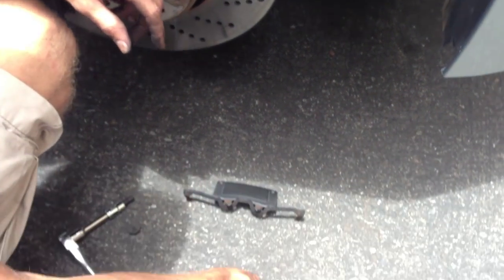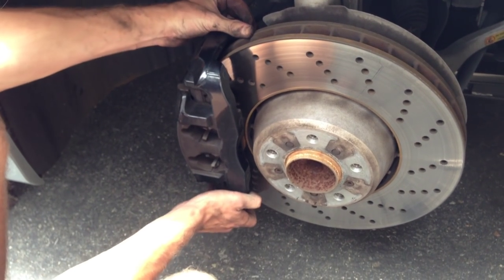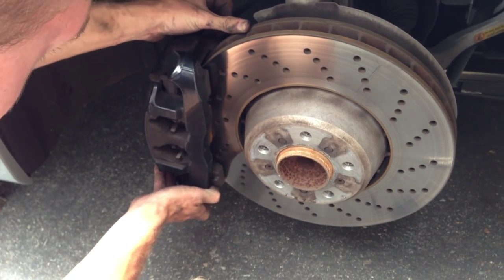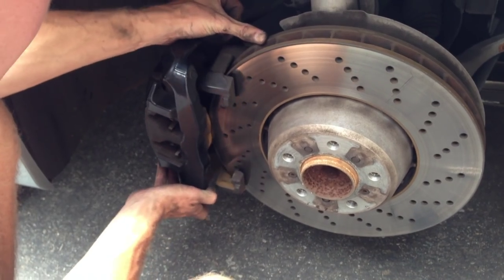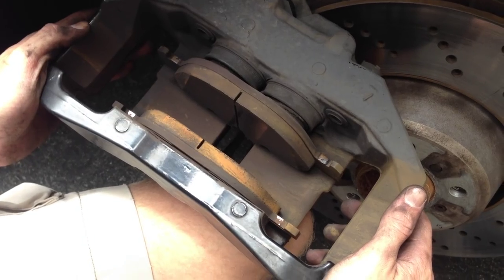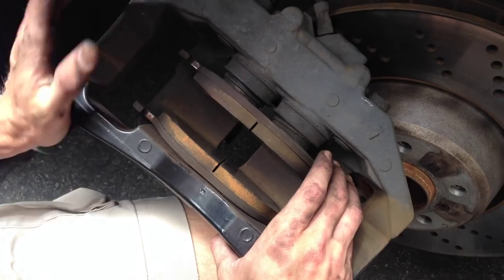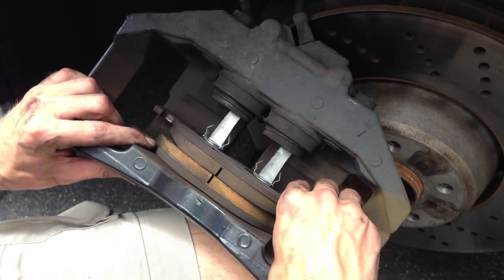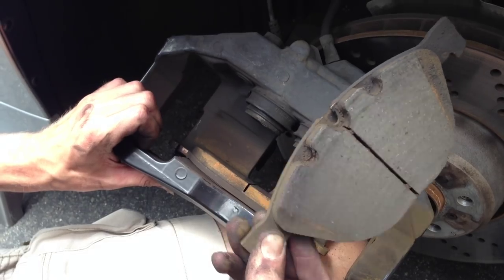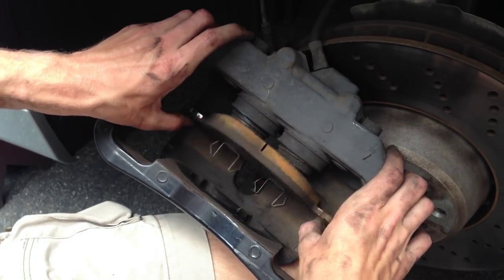The torque on these, since this is a San Diego car, we're pretty much perfect. We should just be able to slide the whole caliper off of the rotor. When we let this hang, we need to be very careful that we don't leave pressure on the brake lines — the best way to do this is with a bungee cord hanging off your spring. With the caliper turned up, we'll see the E60 has two-piston calipers. Grab that on both sides, pull the old pad out — there's lots of life left on these. We're really only doing it to reduce brake dust.